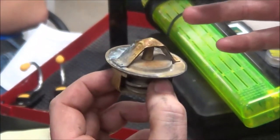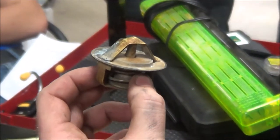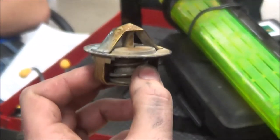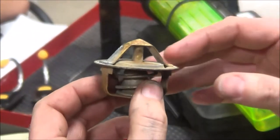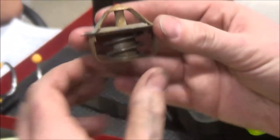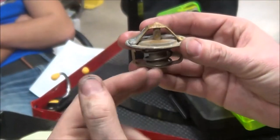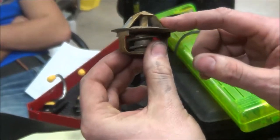That's how we were able to make all those tolerances tighter that you guys saw in your measurements. On an air-cooled engine, everything's looser. On a liquid-cooled engine, we were able to tighten it up. We got better emissions, better power, longer life — all kinds of advantages. So what happens is the coolant goes through this housing that houses the thermostat, and when the engine's cold, this is closed.